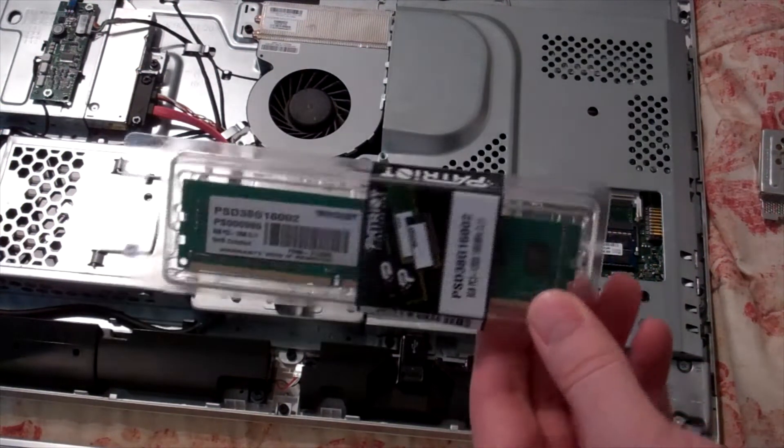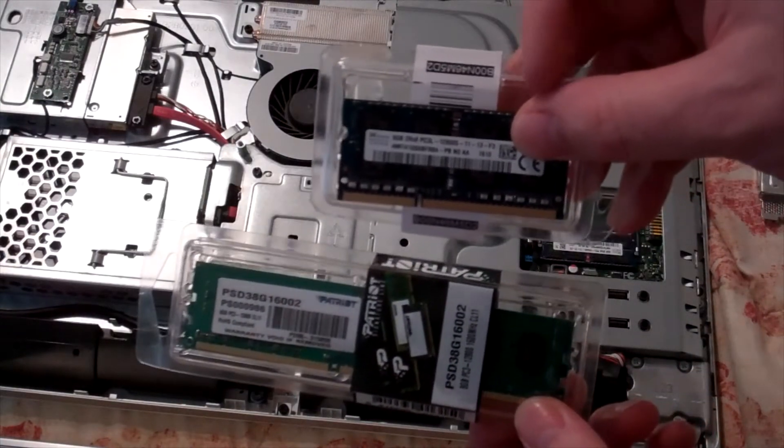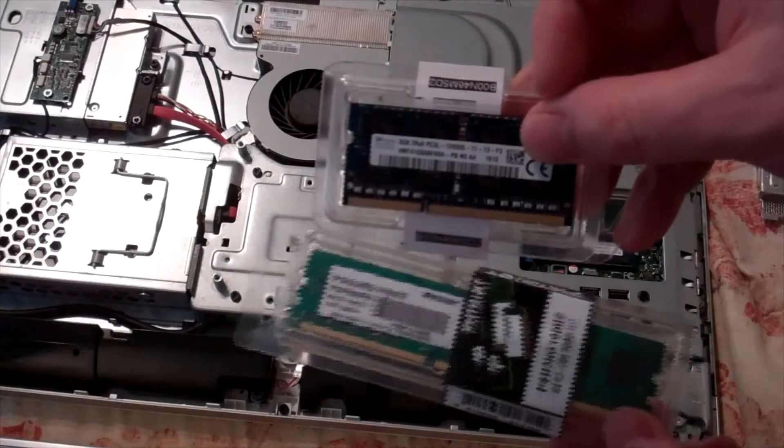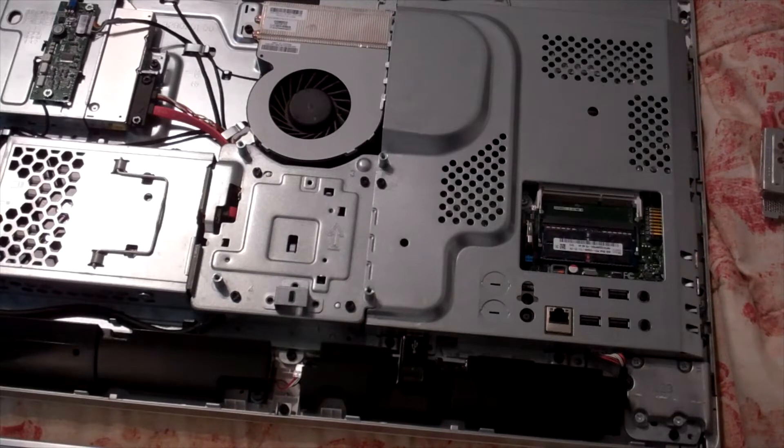You can still make mistakes. This is the regular RAM version DDR3 — it's longer and has a lot more pins. What you want is the laptop version, SODIMM RAM, which is that right there. I believe this is 204 pins — I'll put the correct number of pins in the description down below.